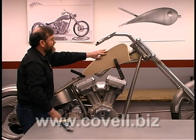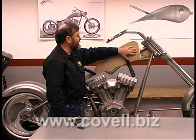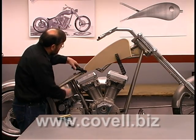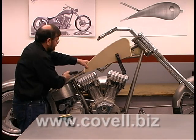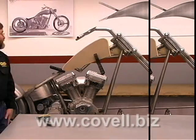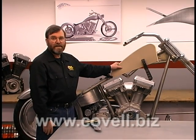There are many ways to position a gas tank. Some of the things I'm looking at: we need clearance at the fork so that when the fork is turned to its limits, it doesn't bump the tank. I'm making this tank so that the bottom edge just touches the top edge of this element of the chassis, and the rear edge of the tank is flush with the bottom of the top frame rail in the rear. I want to be sure I like this shape before we go on to the next step. So what we'll do next is actually make a buck — a set of connected templates to use as a target for shaping our metal pieces against.